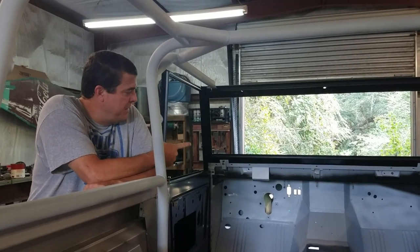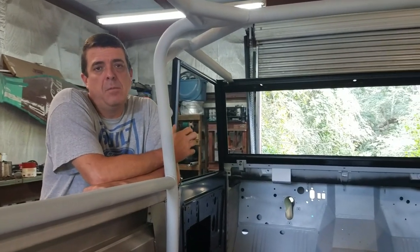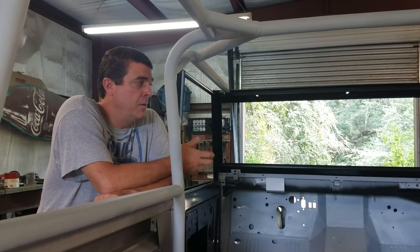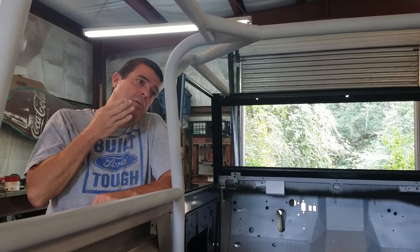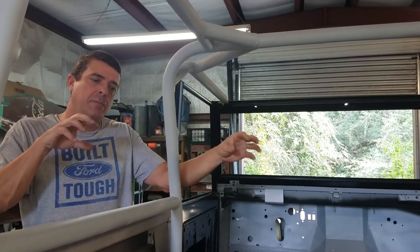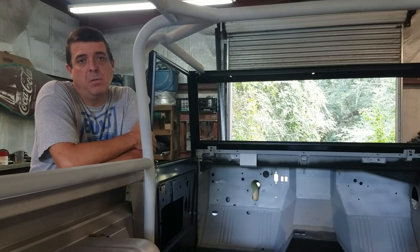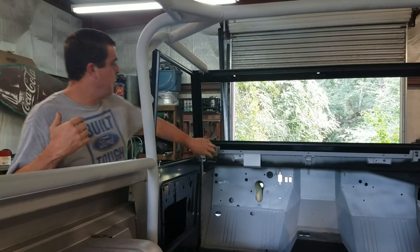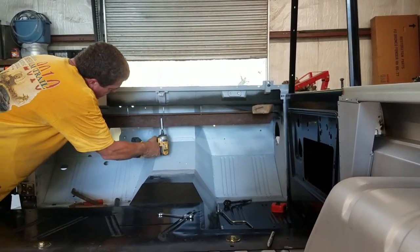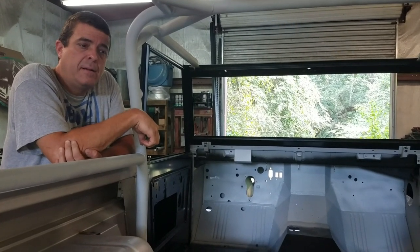I don't always want to show you guys when I mess something up, but I'm human just like all of you. The biggest thing is how you react to it — sometimes you've got to walk away, take a deep breath, and fix it. Sort of like we talked about 'dang it spots.' You can see three little studs hanging out from underneath my dash. When I fixed that rust repair, not paying attention, I put a lot of heat into it because I did a full seam weld front and back. Little did I know — when I went to put the windshield frame on, my support across the Bronco had a crown to it. When I went to put my windshield on and tighten my piano hinge down, it was lifted on the ends. The fix was finding a heavy piece of angle iron, welding those studs underneath, putting a couple blocks of wood under there, and drawing the center of the dash support down. It was a setback, but we got it fixed.